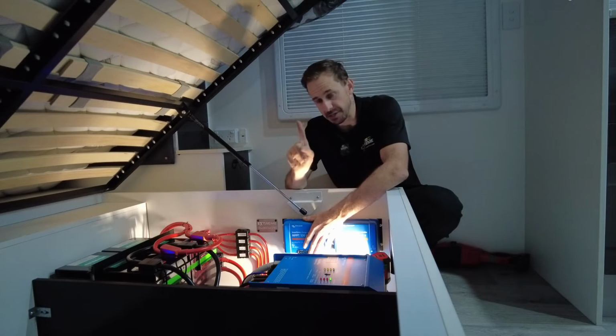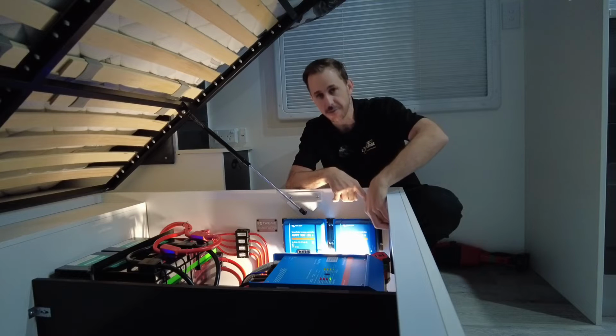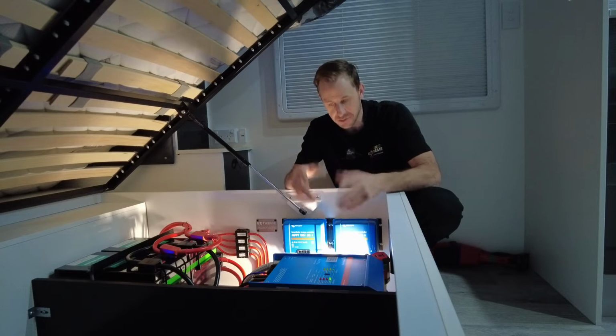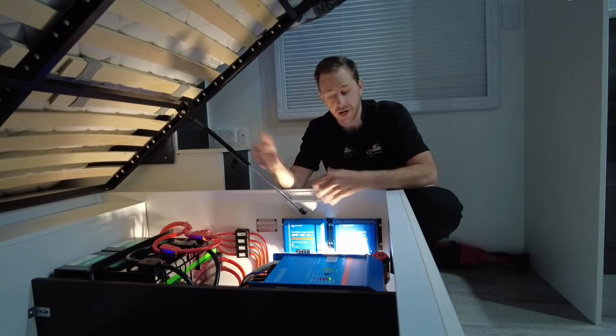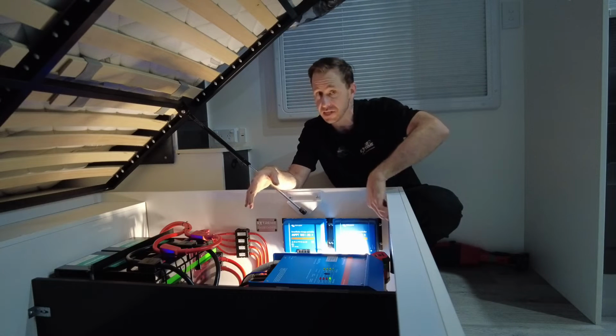So that's a solar 960 on the roof. That is on top of the DC charging. Now on this one, we've gone for the BCDC Redarc 1250 with a side Anderson plug for portable unregulated fold out panels if he wants to add to the 960 watts on the roof. If he parks in the shade, that'll run through the Redarc perfectly, and that's set for lithium. Now that's a 50 amp DC to DC charger, guys.